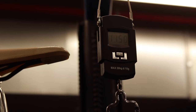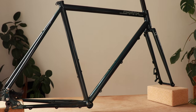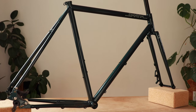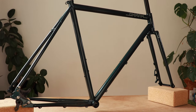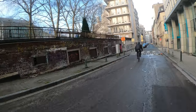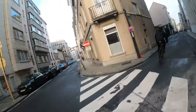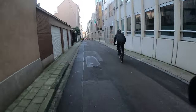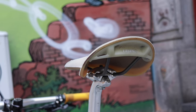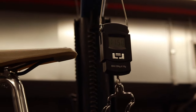The total weight comes at 11.5kg, which is not too bad considering that the frameset on size medium weighs 3.75kg. It's not light, but it is a strong frameset made out of 4130 chromoly and made to withstand commuting life. The components are not particularly light either — the wheelset is at about 2kg, a Brooks saddle is not light, etc. But 11.5kg is fine, particularly considering the price range.